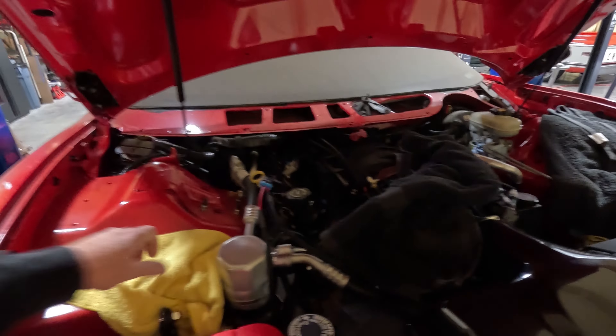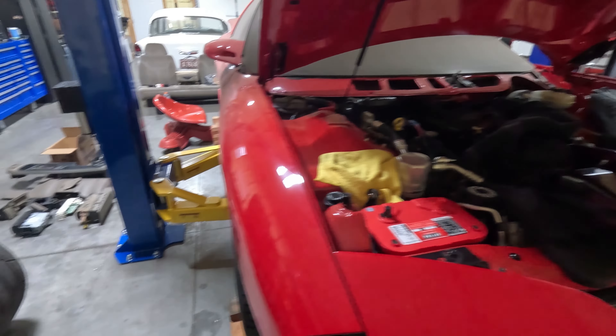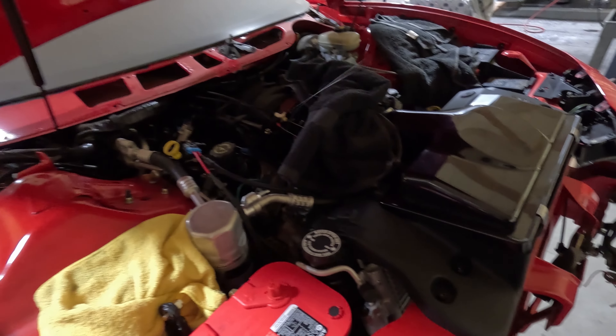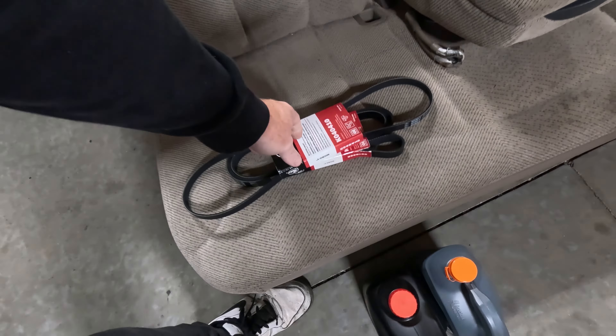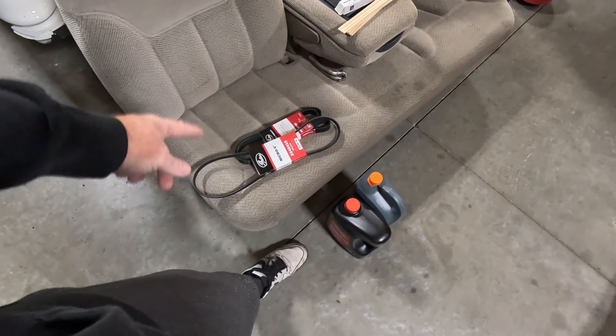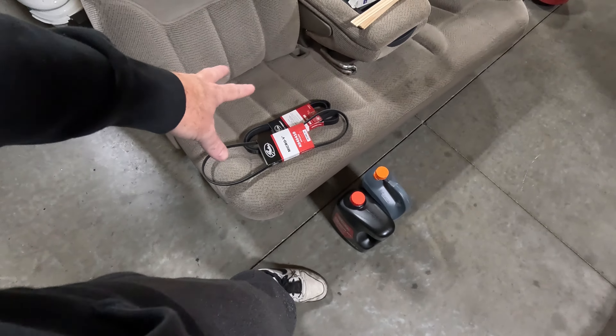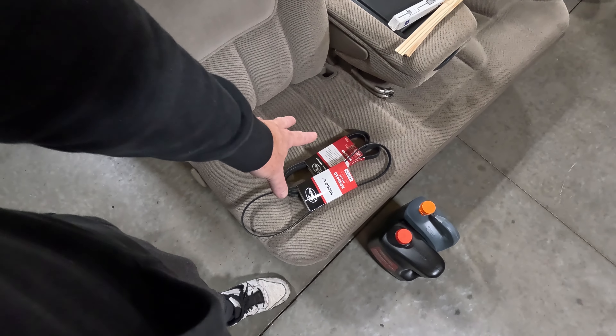As far as transmission fluid, I'm going to grab my long funnel and I'm just using some house brand transmission fluid from a local parts store — nothing special, just Dex 3. That's what FLT told me to use. Let's get our funnel and get some fluid in this thing. Also got my belt in — I ordered a Gates belt, kind of a fan of Gates. I'll try to list those in the description. This should be the stock size balancer — I know it's an ATI but it should be stock size — so I'm hoping the stock size belt fits.